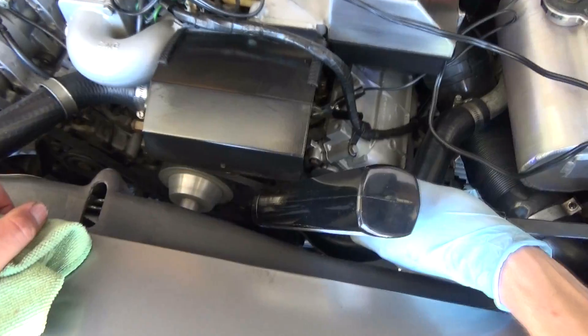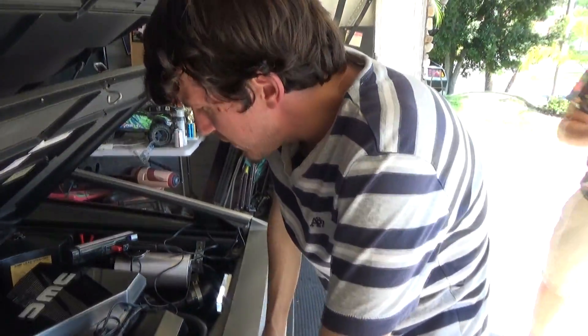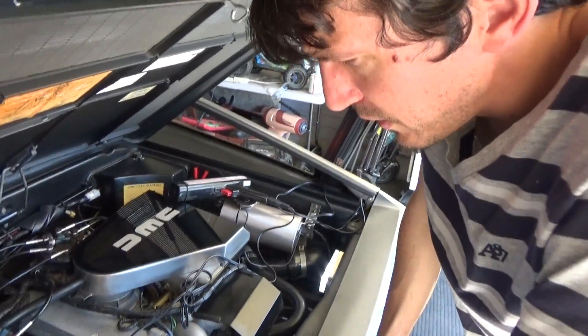So this car is a little bit low, so we're going to make the adjustment. It's slightly off — you can see it. It's kind of hard to pick up on the camera, but it's showing us slightly off. We just tested this car's timing and it's just a fraction off of 13 degrees.